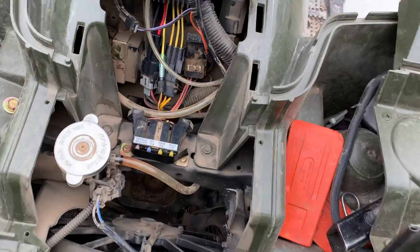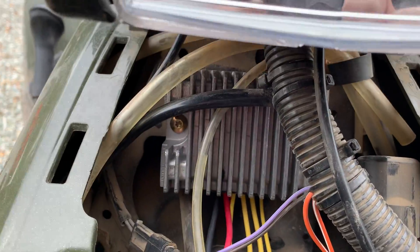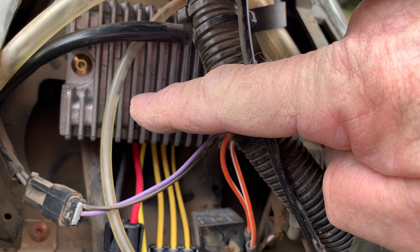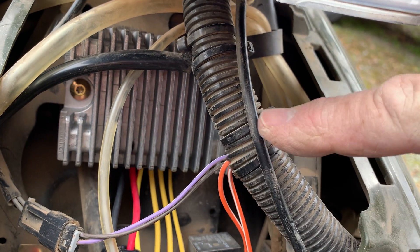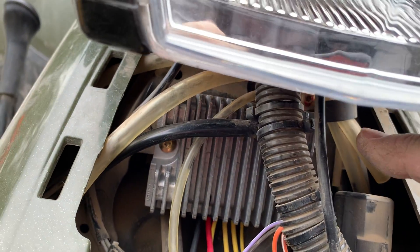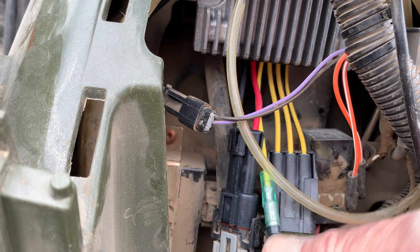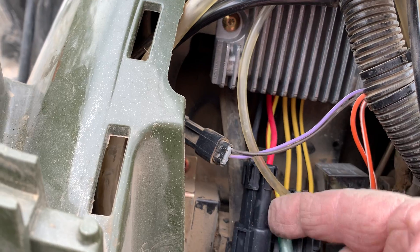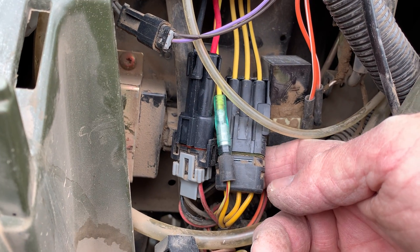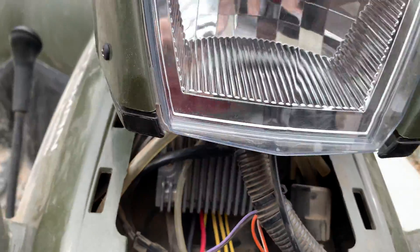And there's the voltage regulator hiding up in there. There are two bolts, one on each side — you can see the one right here, that's a T20 — and there's one over here on this side. Not too hard to get to. Take those out. There are three wires to connect: right here, right there, and right there — these three. Unsnap those, plug in the new one, put the bolts in, and you're ready to go. That's all it takes.